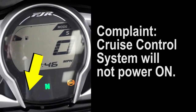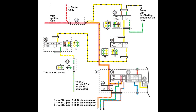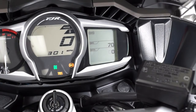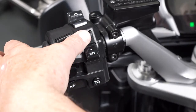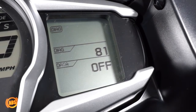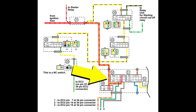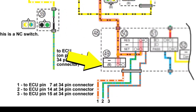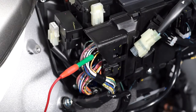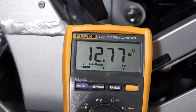If the cruise control system indicator does not light when the cruise control system power switch is pushed, we need to troubleshoot the circuit that turns the cruise control system on and sets or modifies the vehicle speed. Start in the ECU diagnostic system and go to Diagnostic code 80. When the resume switch is released, Diag code 80 should display off and change to on when pushed. Then go to Diagnostic code 81 — when the set switch is released, Diag code 81 should display off and change to on when pushed. If this works, we know the cruise control system fuse is good and voltage is getting to the left handlebar switch assembly, so we'll need to troubleshoot just the cruise control power switch and its wire to the ECU. There's no diagnostic code for the power switch, so we'll need to back-probe pin 7 in the 34-pin multi-connector — an orange and white wire. You should see battery voltage when the button is pushed and it should go away when released.